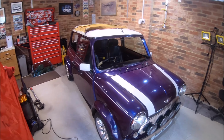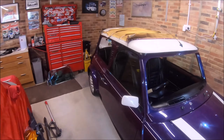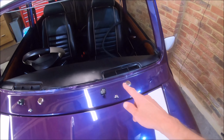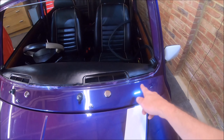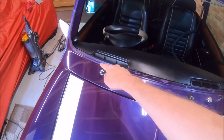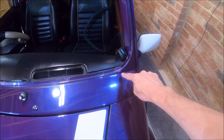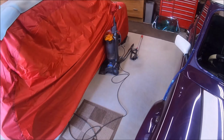Right, so we're progressing nicely. I've obviously got the new headlining parts laid out now, where there were a couple of little scabs underneath the window rubber. They've been cure rusted, they've been primed, and I've just put the first coat of top coat on them. 90% of them are behind the rubber, so you won't see them. This one down here will just stick outside the rubber a little bit, so I just need to make sure that looks nice.